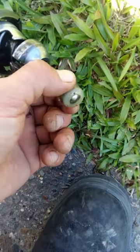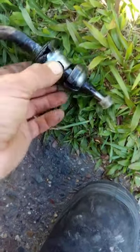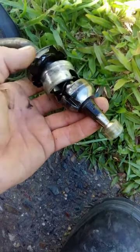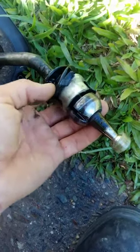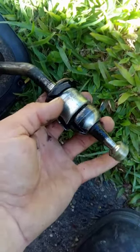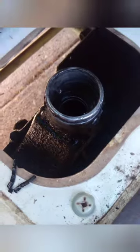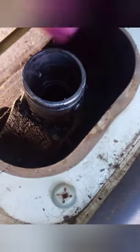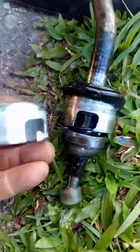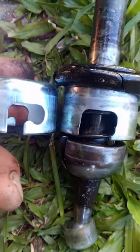It's all loose — that's why there's so much movement. This lock ring wasn't locking in place, that's why it was lifting up. I also have to replace this. It would be ideal to replace this seal as well, however Bursons, who I got it from, couldn't supply it. So I'm only going to replace this part and the locking nut. Look at that — it's worn out. That's why it wasn't locking in, because there's nothing to lock it in place.